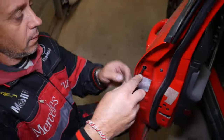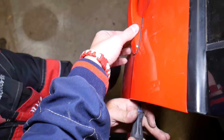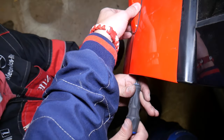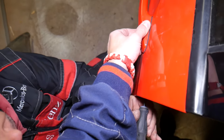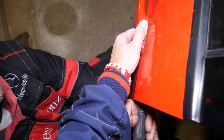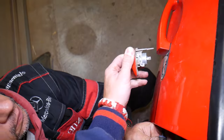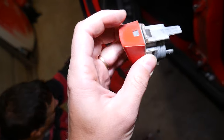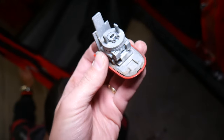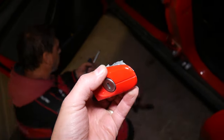Once you get the bolt started getting loose, start unscrewing it. While you're unscrewing, one person should grab the cylinder door lock and pull it out — eventually it will come out. Once it comes out, stop unscrewing. Our cylinder door lock is out. If you want to reuse your cap, it usually has one clip holding it and three little ones on the sides — ours is the same cover so we'll reuse it later.